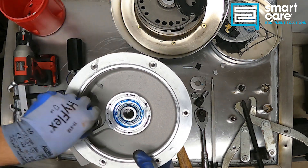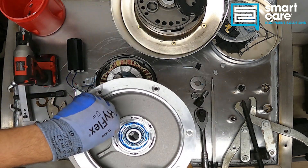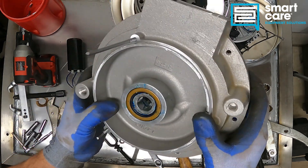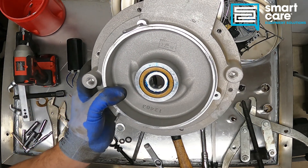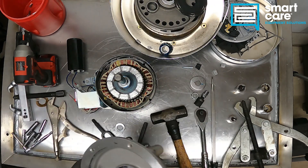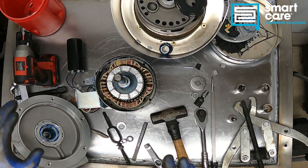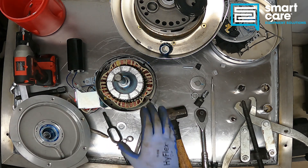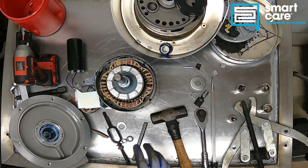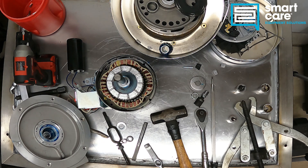There is another seal underneath here to keep anything from the outside from getting in. So you can imagine the amount of work it just took to get this thing apart with it being brand new but shipping damaged. Once this has been in service long enough that the seals have started to fail, it's a huge job to overhaul — it's really almost never worth it as far as how much time it takes and how much struggle you put in to get the machine apart to this point and get new bearings pressed in.